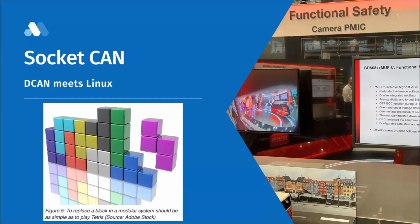For example, if the application needs to use the CAN0 device, the operating system invokes this device and every access is forwarded to it. Socket CAN is the driver networking layer created by Volkswagen Research. It's an open source project and takes the most opportunities from the network device. It's not as limited as the previous character device implementation.